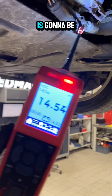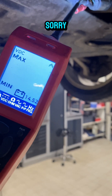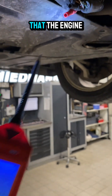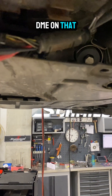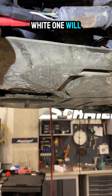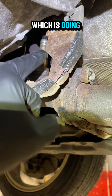We'll take a quick check of the oxygen sensor fuse — that's going to be okay. The heater has 12 volts. It will also have 12 volts on the ground side — don't worry, it's not shorted; it just means the engine doesn't need to activate the heater yet. The DME on that particular gray and white wire will ground it, which activates the heater.